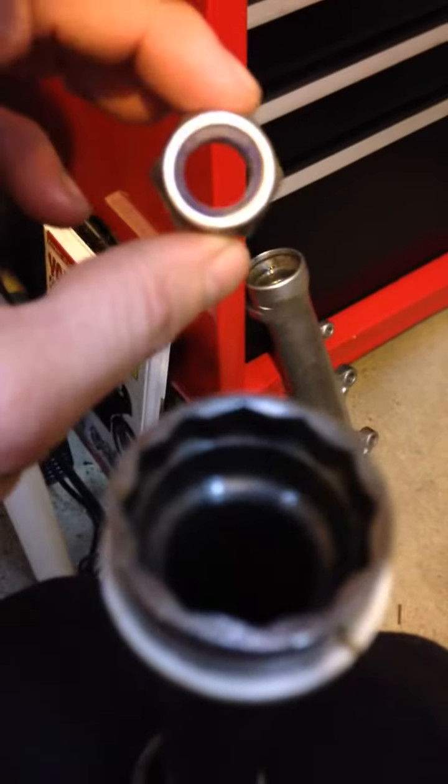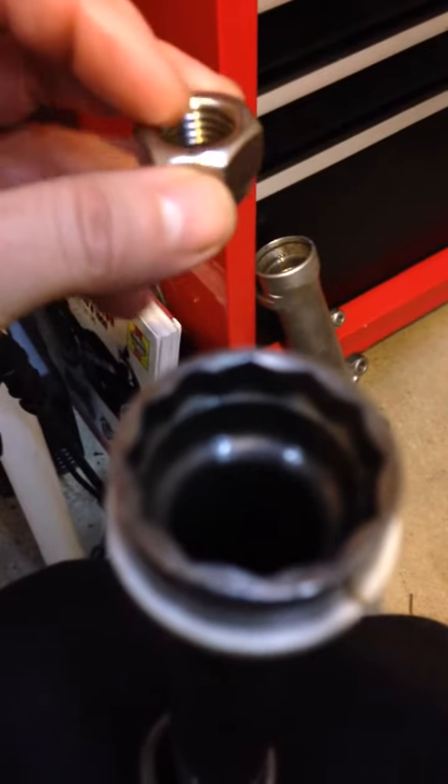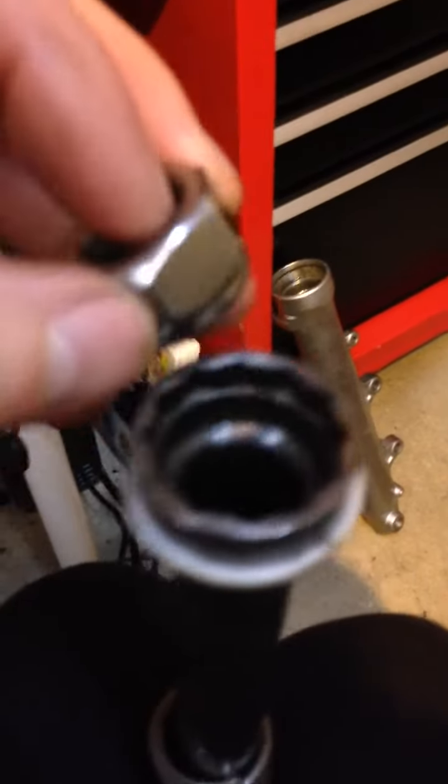The solution on the FZR turned out to be quite simple. After many attempts to jam it and hold it, all unsuccessful, I found that a nylock nut — 24mm across the flat, I believe it's an M16 — actually drops face down perfectly into that rod.